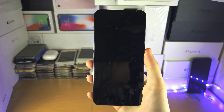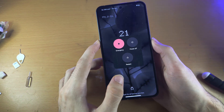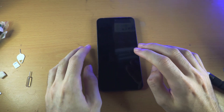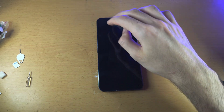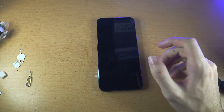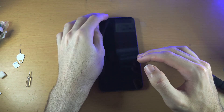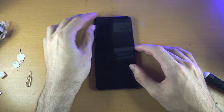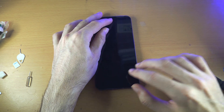I'm going to move the camera. Take your Nothing Phone — yours is probably off, so turn it off. We're going to use two fingers and tap really hard all around the phone with maximum force. We're essentially trying to put pressure on the phone so the disconnected connector will reconnect. I'll use one phone to stabilize since it's a little rocky.